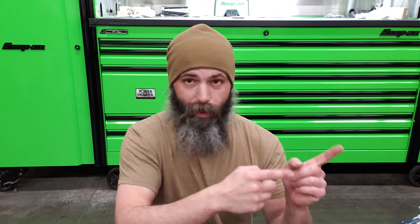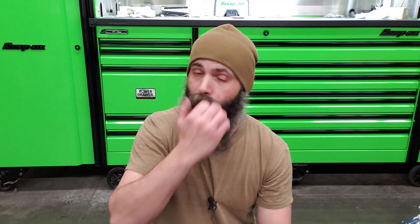Turned everything off, hit the main disconnect, pulled the battery cover off to go disconnect batteries. And those didn't look too healthy — flashed my light around them real fast and a couple of them were starting to look a little swollen, a little distended along the side. Took all the battery cables off, cleaned them up real fast, zip-tied them up out of the way, and started checking batteries. I just checked two batteries, called it good, and started changing batteries out. Luckily I didn't have to spend a couple hours changing a starter. We've had it happen before — truck doesn't want to do anything and it started fine ten minutes ago — time for a starter. And 99% of the time that's what fixes it. This case, it was the batteries.